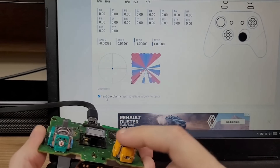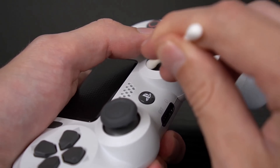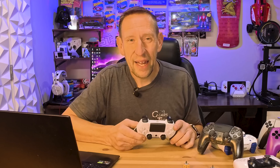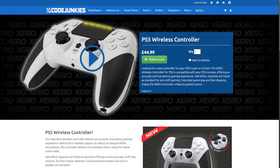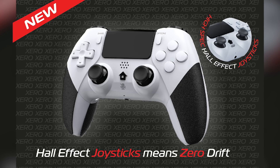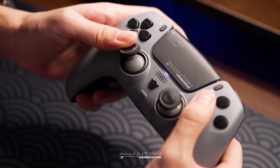The real impact is that we no longer have to do controller calibrations, blow air down the sides, or clean with Q-tips and wipes — those days are gone. Buying a medium-to-high grade controller with Hall effect sticks is more affordable than ever, and increasingly so with TMR sticks. For example, this Zero controller sells for about the same price as a DualSense, offers programmable back buttons, and already includes Hall effect sticks — so it's available in mid-spec controllers too.